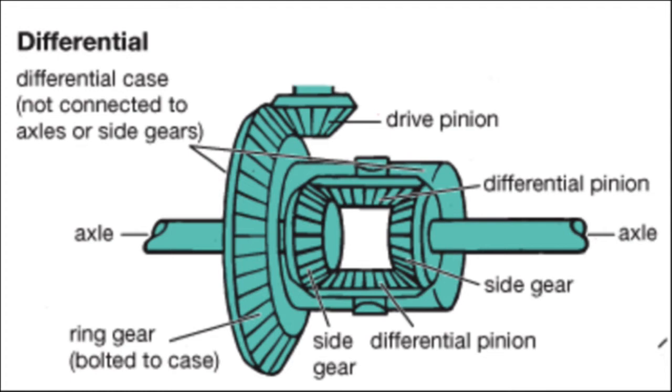But where, of course, you do have two wheels being driven, now you have to make sure that they can operate at different speeds to allow the vehicle to turn effectively. Now, they don't have to be in the center. When we think of differentials today, you think of them in the center of the axle. Not necessarily so. If you have a vehicle, particularly a chain-driven vehicle with only one chain driving the axle, you'll have a differential on it off the side where the chain is. Or if you have a transverse engine, which did happen, you would often require the differential to be on one side. And then, of course, you have the invention of all-wheel drive and four-wheel drive and having differentials in different places. So we'll probably talk about that in more detail.